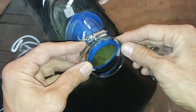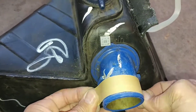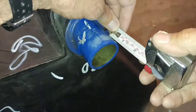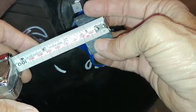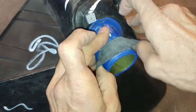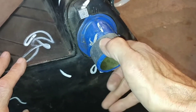If you look at this replacement hose clamp, you can see it's much better able to conform to the surface of the neck when tightening down. When you're under the car it's going to be tight — that's why you want a band of sandpaper like this. You can just grab it on each end and work it for a while until you feel those castings become nice and smooth. Once you get those fairly smooth, you'll put the band on. You'll notice the clamp surface is only about an inch long, but I cut the tube a little longer than that. When it stretches over the neck it shortens, so it's a perfect fit on that clamp surface. Make sure all the folds are out of the tube so you get a nice fit.